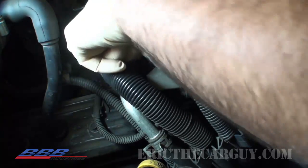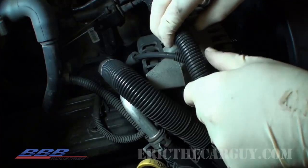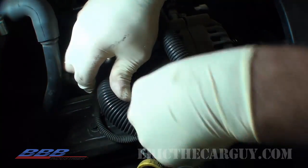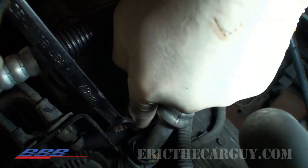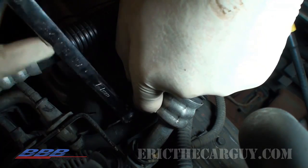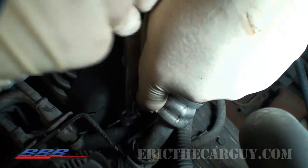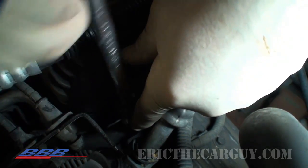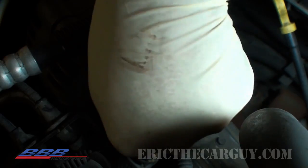Next, I want to disconnect the electrical connections. Here's the main output wire on the back that I'm going to get — looks like a 13 millimeter. And then there's one more connection on the side right under here. This is the main power feed coming out of the alternator itself. If you happen to touch metal and touch this back here, you're going to short something out. That's why you want to disconnect the negative battery cable — put the car to sleep. The first step in just about any major repair in a manual is to disconnect the negative battery cable. Avoid any situations where, like if I took this wrench and touched this metal right here and that circuit was live, we'd see some sparks — and we might break something.